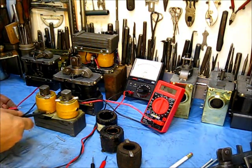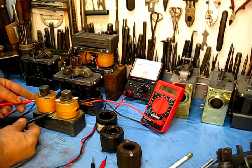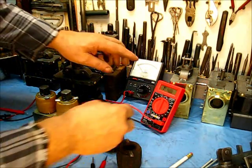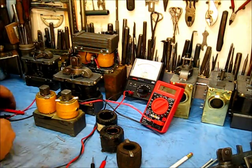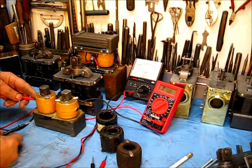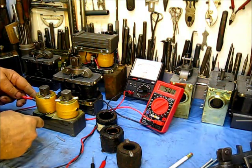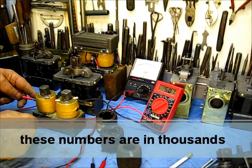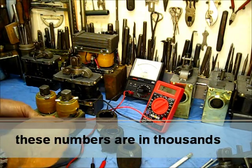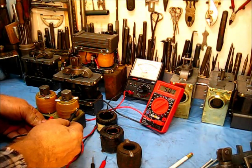The secondary being this spark plug winding — let's use the digital meter first. You have to set it on 20k. Now it makes no difference positive or negative, just stick one probe to one lead and the other probe to the other lead. The readout is five point zero seven. Let's check the other one: put the probe to that lead out and the other probe to the other lead out — we've got five point nine.